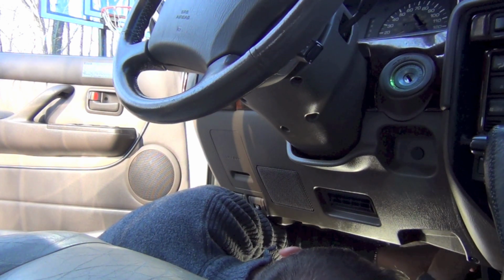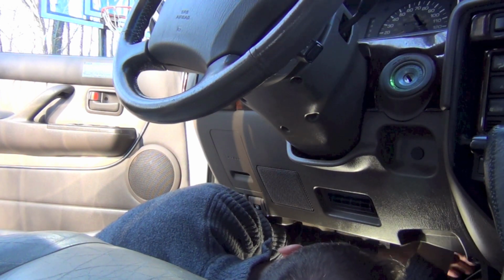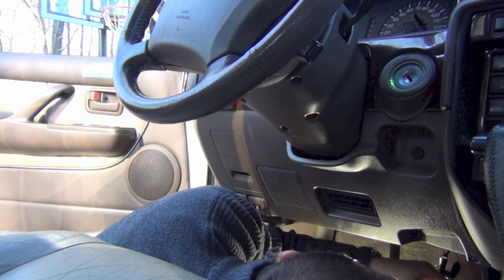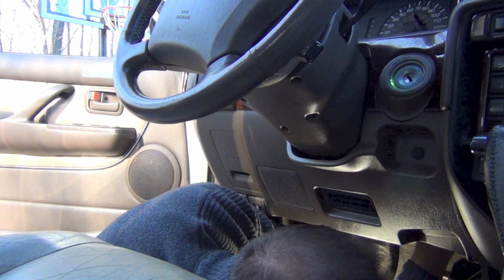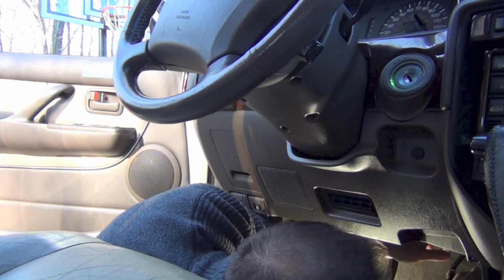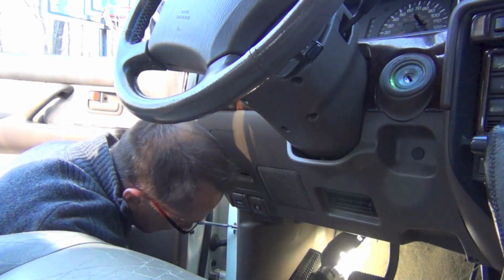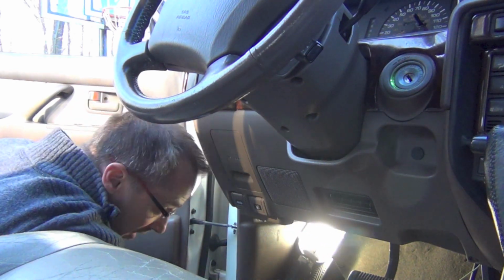Start turning it down. That little gasket on the back of that thing keeps this waterproof, because as you go through those deep water crossings that you want to do with your Land Cruiser, water could start coming in any of these holes. And one thing I see here that's going to be another project is the gasket around my steering bar as it goes out is also broken, ripped. It's a round gasket around that thing that flexes, and over time it gets to where it's not going to work.